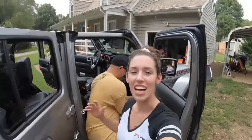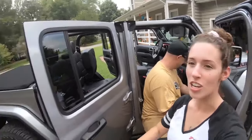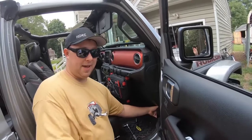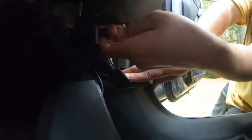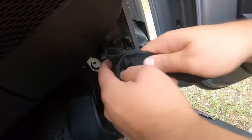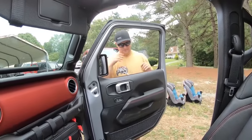Ben is finally on the last door bolt. We've been working on the doors for probably 15 minutes — the whole experience about 30 — and it's time to get the doors off so we can actually see what this thing looks like naked. All we have to do now is pop this little panel off, pull it out and up. We have to push this red tab up and then flip the white piece up. Then we can go ahead and undo our door strap, pull it off, fold our mirror in, and pop the door off.